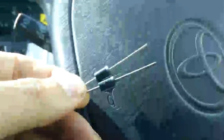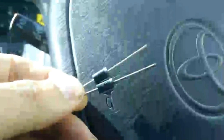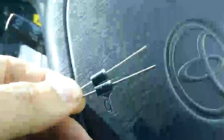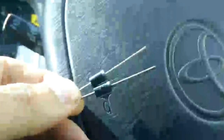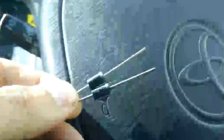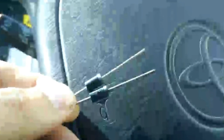Every alternator has an alternator sensing wire, which is one of the wires in the 3 or 4 pin connector that you plug into your alternator, generally 3 pin. The alternator sensing wire senses the voltage of the battery and therefore maintains voltage — it tells the alternator how much voltage to put out. So by putting a diode on that sensing wire, you're dropping the voltage by 0.5 volt increments. The alternator then sees it's not giving enough voltage and boosts it to compensate.